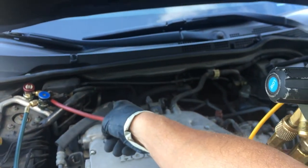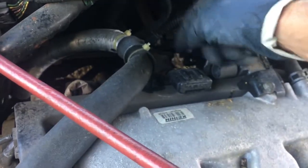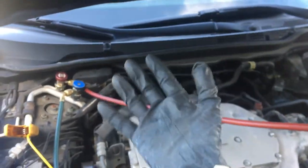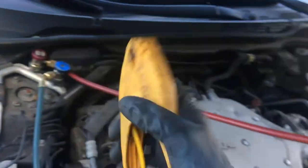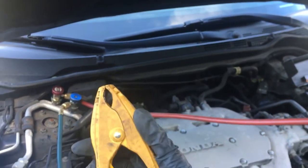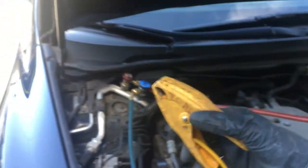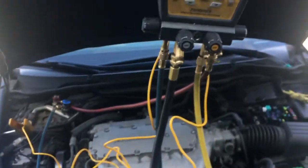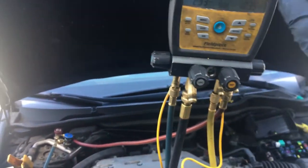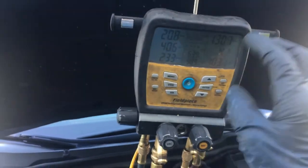SLT — suction line temperature. Not the most ideal location but it's better than none. The ideal location would be right up there out of the evaporator, but on a lot of cars, especially a V6, you have a hot exhaust manifold down here radiating a couple hundred degrees that will strike your sensor and heat up the plastic and change your reading. You've got to stop putting these in line with radiant heat. If you do, wrap them well in rags, or keep a piece of crinkled Reynolds Wrap foil with the reflective side out — that will stop radiant heat from reaching your sensor.